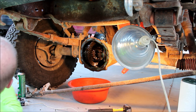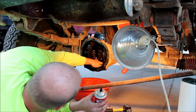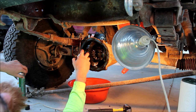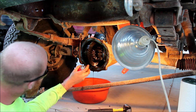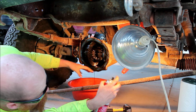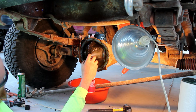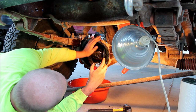Because if you don't do this, your weld will not stick. You've got to try and get as much brake cleaner out after you're done, or it'll catch on fire — which I'm actually looking forward to. We can blow it up! The last time I shaved my beard was when I blew up a container full of brake cleaner doing this exact project on a Dana 60. It was draining into one of those enclosed cans, and when I went to weld, it dropped down all gaseous inside, blew up the can. It singed my beard so bad it smelled terrible and I had to shave it off. The wife was mad.